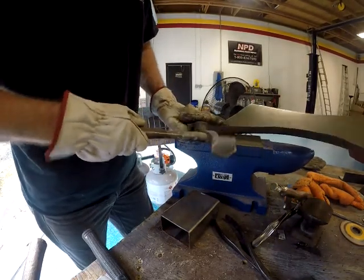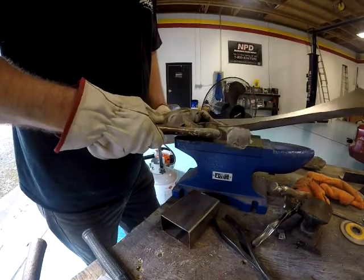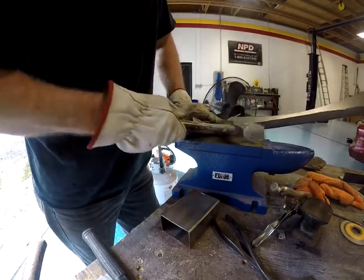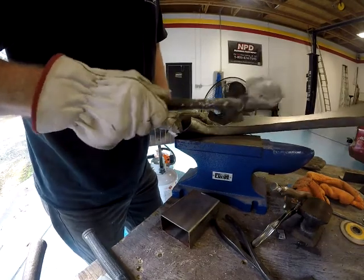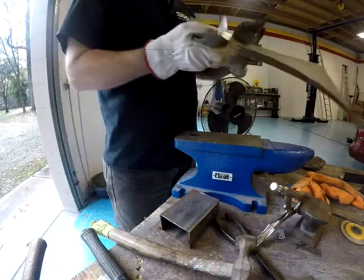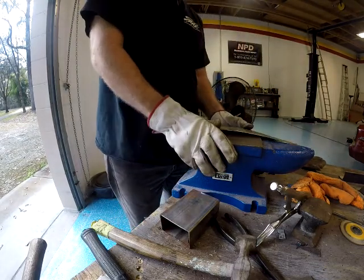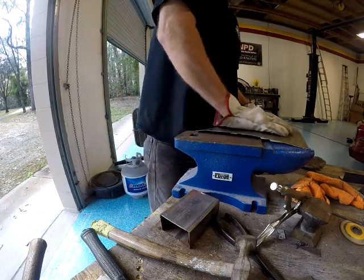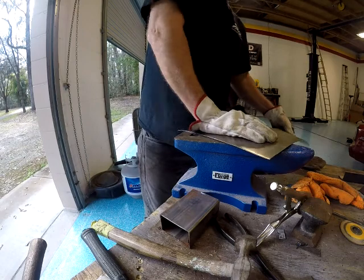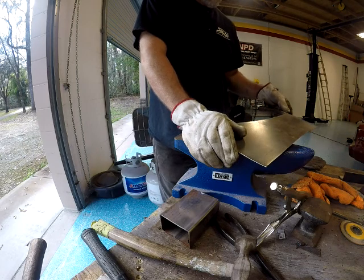So more bang, bang, bang. Again, this took several hours to actually make. And we're getting a little aggressive right here. And that little straight part, you see how it's warping? It's warping my panel. The more aggressive I got with the flange, the worse that warp got. But you just come back and push it with your hand, straighten it all back out. Now again, every time I did that, it changed the angle of my flange again.